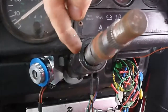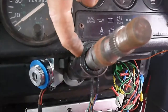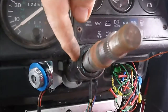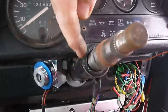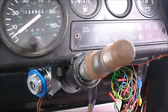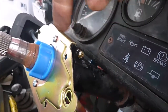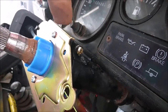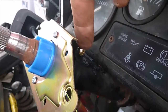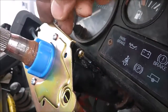Be aware there is actually a key in the steering column so that the indicator stalk mount gets into the right place — don't bash it on or you'll break the plastic key in the stalk mount. Once you've got the keys lined up and the stalk mount on as much as it will go, tighten the screw back up. Don't over-tighten it or you'll thread the plastic behind it.